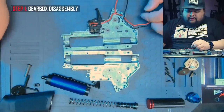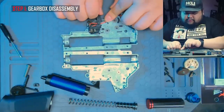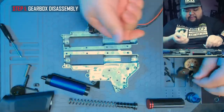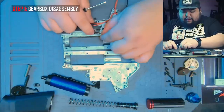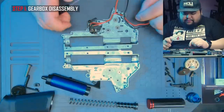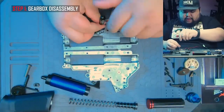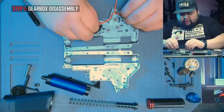Lastly we need to remove the trigger and the trigger assembly. The trigger is spring loaded so be a little careful — remove it at an angle and it should come right out. There's the spring; just set that to the side. Then lastly the trigger trolley and assembly. There's a spring right here — hold your finger down on it so it doesn't shoot across the room, remove it from its post, and then you'll need a small Phillips head to remove the screw right here. Once you unscrew that, lift it up and be careful when removing the wiring.